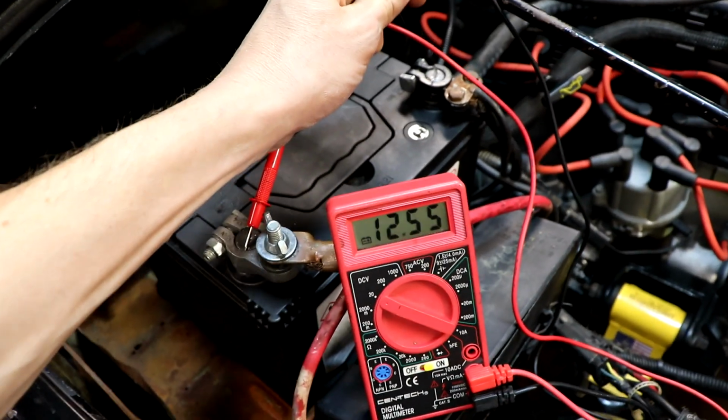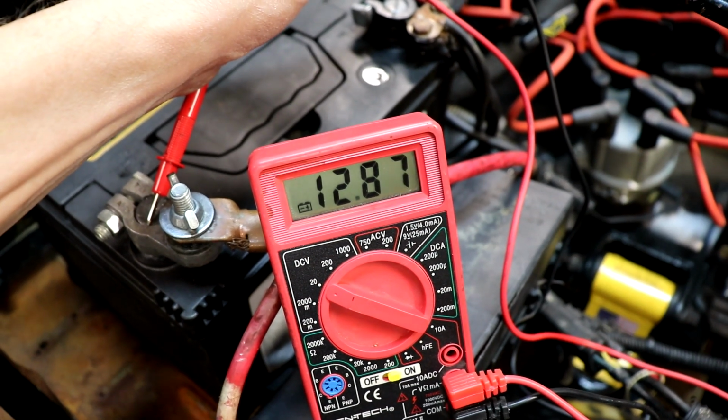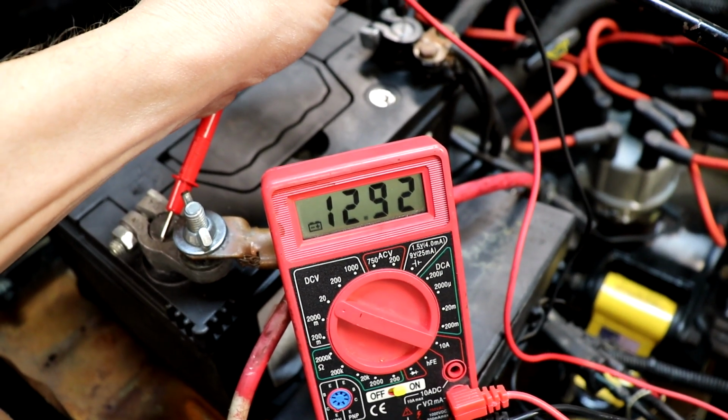So we thought, let's measure the voltage at the starter. Well, the battery first. We double checked the battery, make sure we had enough voltage to turn over the engine, and I think even put a jump starter on it, and still we're just getting the click. So then Jason started fiddling with the starter. Yeah, I put some leads.